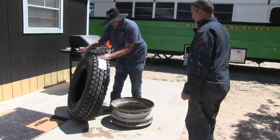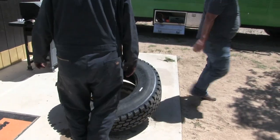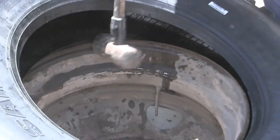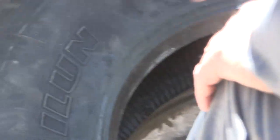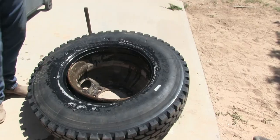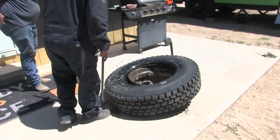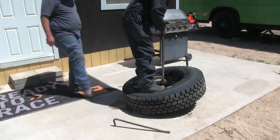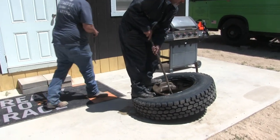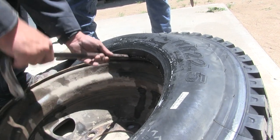If I had the right angle I could have got it — I didn't realize I had to go up that high. Let's just get the rubber mallet and finish it before I hurt myself. You take this and — oh, that makes sense of the rubber mallet part. It's easier to get it started like that. If you don't get it started first, it doesn't want to stay as you hammer. The rubber mallet keeps you from damaging it. You want to stand on it so it goes down into the groove as you're pulling. You've got to get the tire down to the center so there's room to move over. It's going slowly but it's moving.